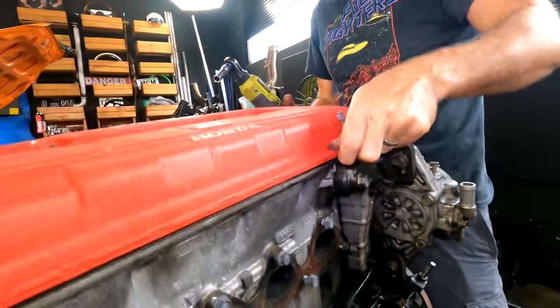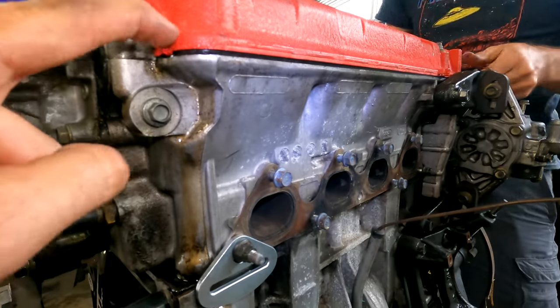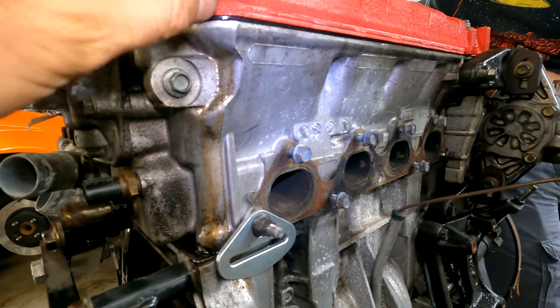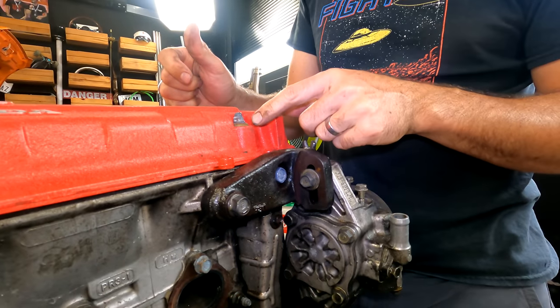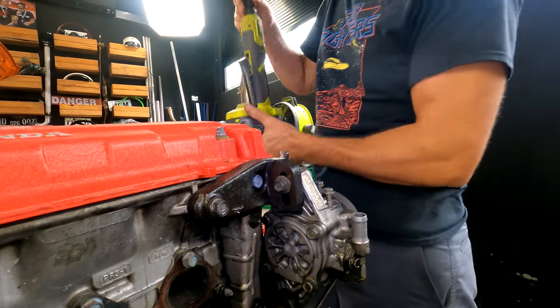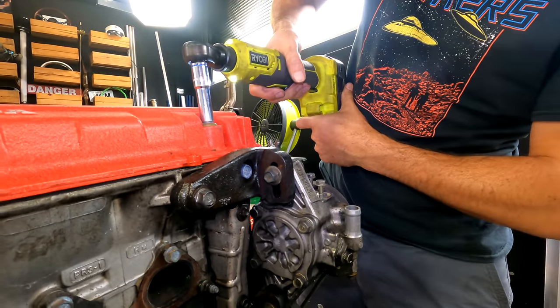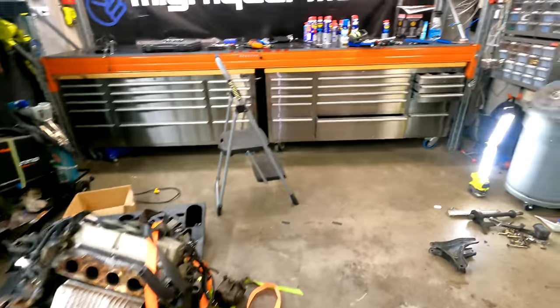One reason you would also consider taking this off is, firstly, some of them are finger tight. And secondly, is this oil coming out? Can you see this oil coming out? That one's off. Spinning the stud, I think, but then the stud's not actually coming out. There's nothing to do but keep undoing, I don't think. Maybe put some pressure underneath it. I reckon we're going to have to do that and pry at the same time.